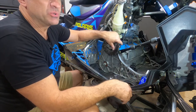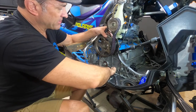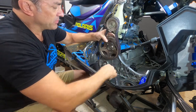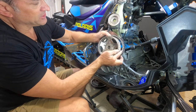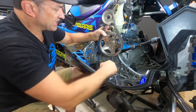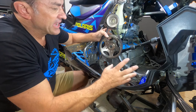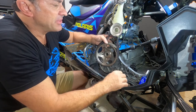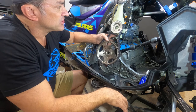This particular sled — last season we installed our Quick Drive 2 on here. On the older sleds, the older Axis from 2016 to 2020, it didn't come with Quick Drive 2. Since this lower drive gear is so much larger — you can see how much bigger that gear is on the Quick Drive 2 compared to the old 43 tooth gear — it takes up a little more room and you've got to account for that. I have a video on how to install the Quick Drive 2 on your 2016 to 2020 Axis. It makes a really nice difference on low-end pop and get-up going from the 1.95 ratio on the stock Axis gearing to the 2.27 gearing.